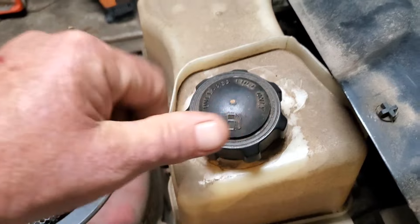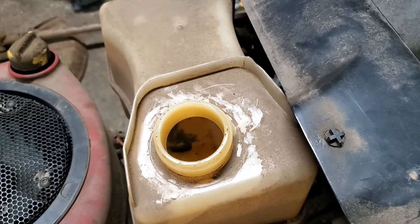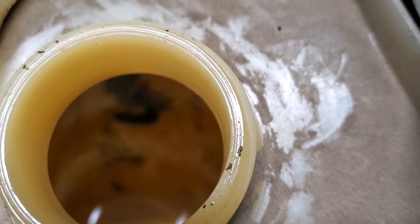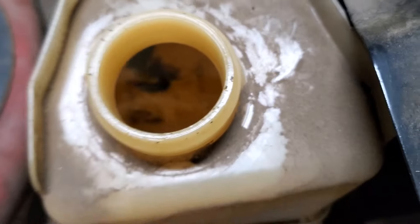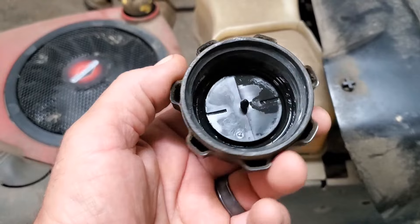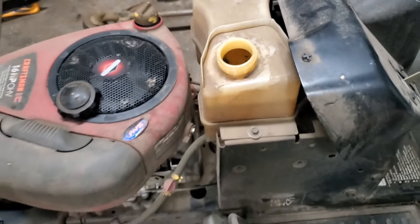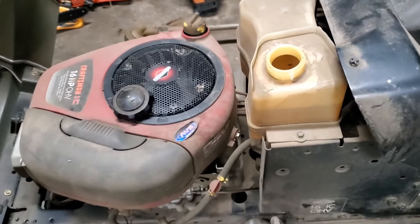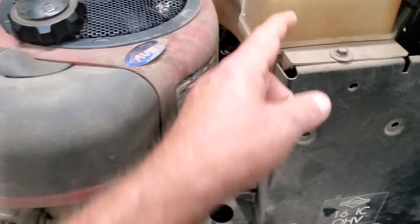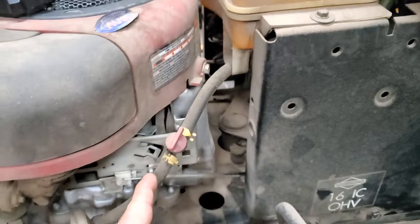The first thing I look for, I go right here. Look what you see down inside of that fuel tank — see all that mess down in there? That used to be inside of this gas cap. I'm 99.9% sure that is our problem. What's happening is that stuff is getting over here, stopping up, and not letting fuel flow.